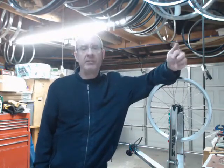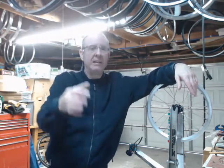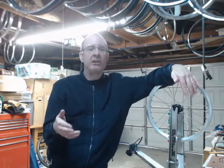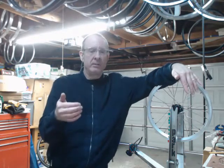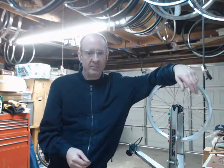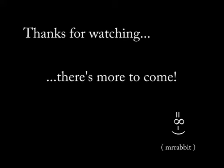In review: to stress-relieve a bicycle wheel, you need to induce approximately a 50% increase in tension in the spokes, bringing those spokes closer to their yield point to a higher level of stress, and then let that tension go, allowing the spokes to drop back down to their lower tension in a more relaxed, stress-free state. Doing this helps you get the maximum life out of the spokes, as close as possible to the theoretical life expectancy of the spoke in that wheel. Thank you for watching. If you have any comments, questions, or suggestions, you can visit my website at www.mrrabbit.net, follow the link for Wheels by Fleming, and at the bottom of the main page is my email address.